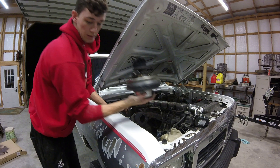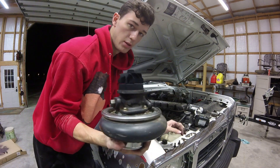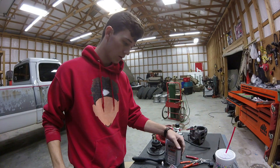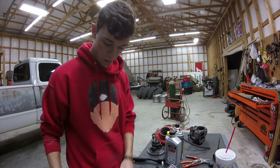There's that big old 76/67 turbine wheel. We're going to take this back over to the bench. That's a 10 mil 12-point and a 19 mil 12-point as well to get that off.